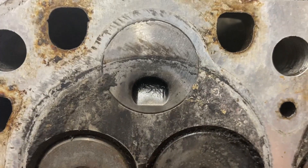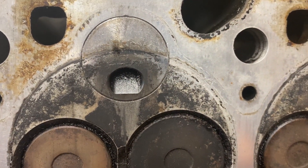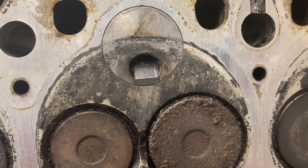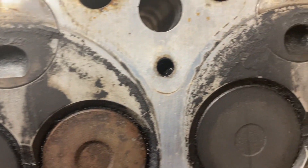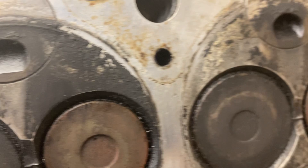They also tend to crack by these pre-chambers, but it doesn't look like it's cracked at all there. Next video we're going to be taking this head apart so I can get some feeler gauges into those cracks. It doesn't look too great, but we're just going to play the hand we were dealt.